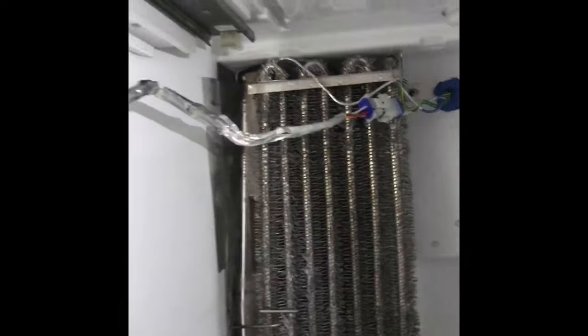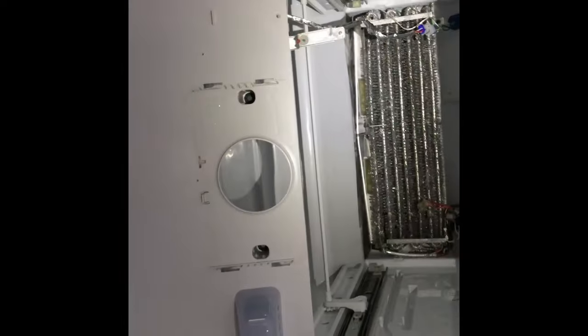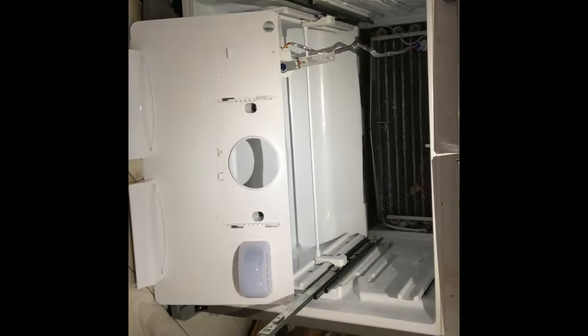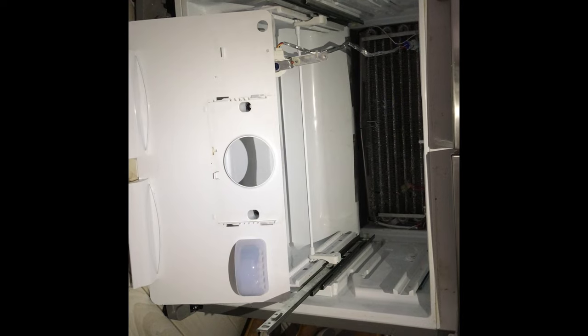There's the motor — got to remove it from the bracket. There's a little zip tie. I replaced the zip tie with the stock one that was on there — cut that, took that off. I'm just eyeballing stuff now, going, okay, I got to put this thing back together. Just go slow. Even when you're pulling the fan blades off the spindle on the motor, take your time, go gentle. You do not want to break the fan blades and then have to wait for another part. Just slow and steady. If you're not sure what you're doing, back away, go look at the schematic.